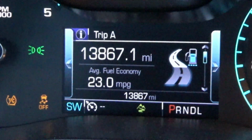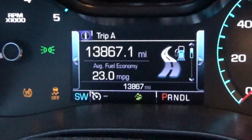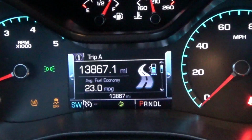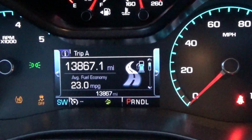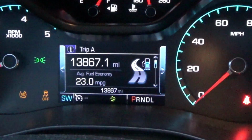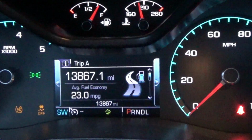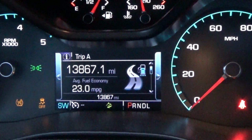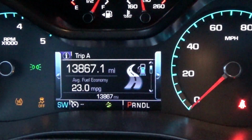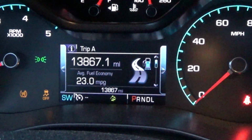And that is stability completely disabled. And that will allow your off-road mode to work better and more function when you're in four-wheel drive, going up hills, slippery conditions, what have you. It will help not reduce vehicle speed or cut your power. You may have seen in one of my other videos when I was going up the snowy hill climb and it cut power. That's because I had forgotten to re-engage my off-road mode, and the engine felt that the tires were slipping too much, and to keep it under control, it would cut power.